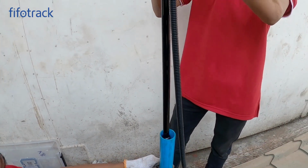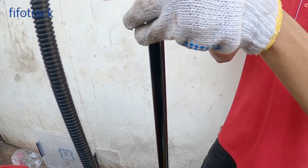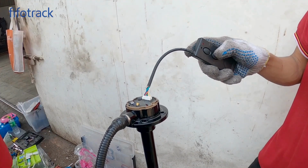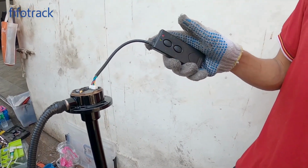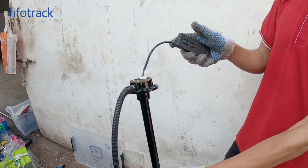After the liquid is fully drained, press and hold the E button for about 5 seconds until the green light flickers fast, then release. After about 10 seconds, the green light will turn off. This indicates the calibration of empty level is completed.